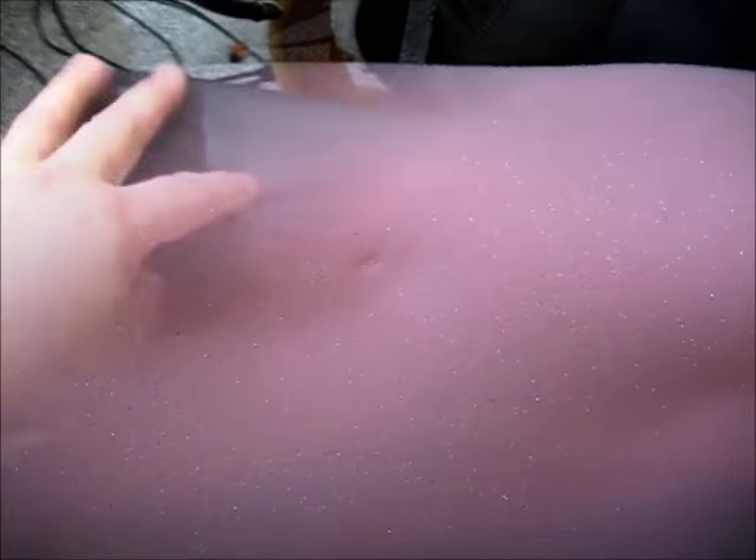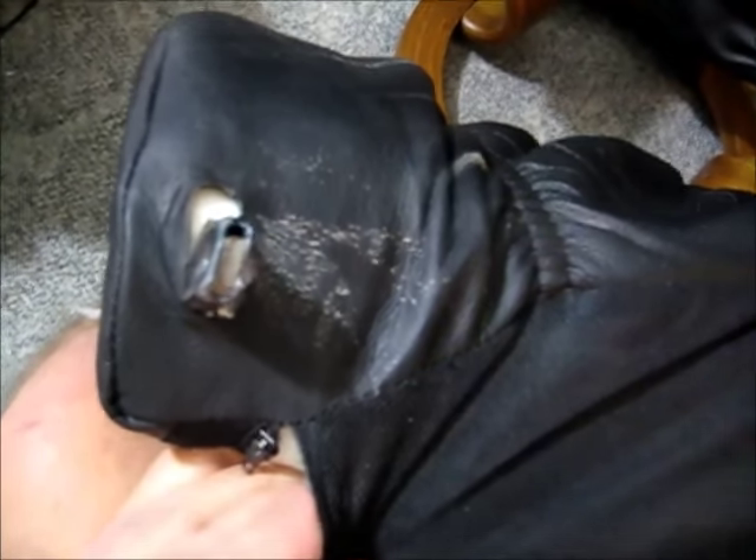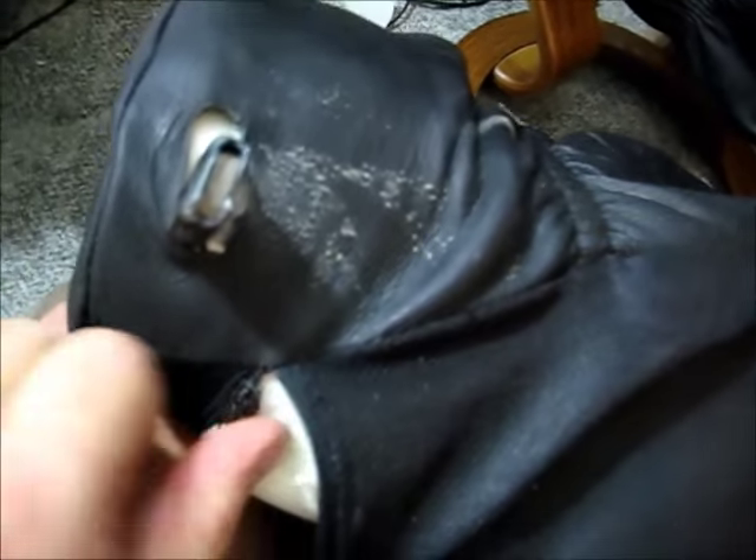Here's the new cushion. We've got to get the leather part back on top of it — it's not exactly easy, but just be careful not to rip things up. Take your time, stretch it and go easy. Your first goal is to get both of the side holes on there and aim for that, then wiggle it into place so there's not a lot of stress. Bring this over the top and get the hole into the fitting — don't rip it. Once both sides are on, zip the back up, and then it's time to put the chair back together.